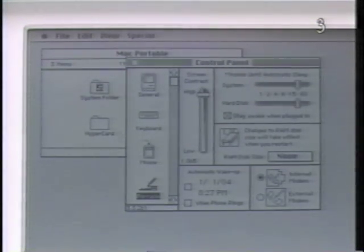The Macintosh Portable has another power-saving feature called Rest. After 15 seconds of inactivity, the microprocessor slows down from 16 megahertz to 1 megahertz. The microprocessor returns to full speed as soon as you resume work. Each time you wake the Macintosh Portable up, you should check the battery level before you begin to work.